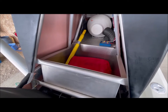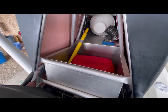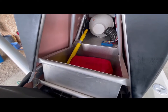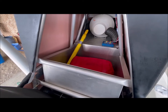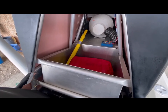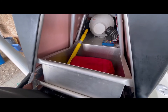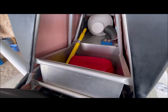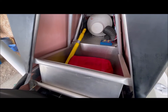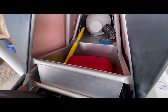This is an XL65, so where in the past you would have seen a fuel tank, you now have a baggage compartment which currently contains an emergency kit and the paddle for float operations. The wing tanks hold 20 gallons of usable fuel — 10 in each wing — giving you a range of about three hours at normal cruise on floats, including reserve.